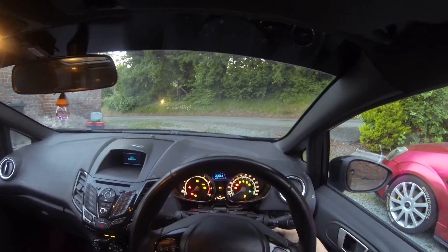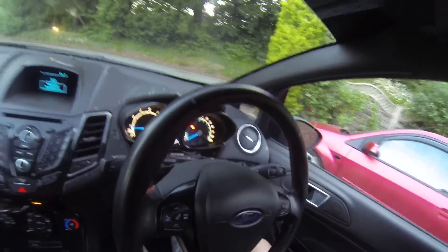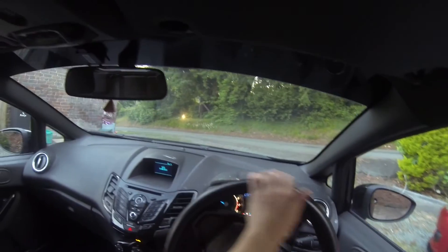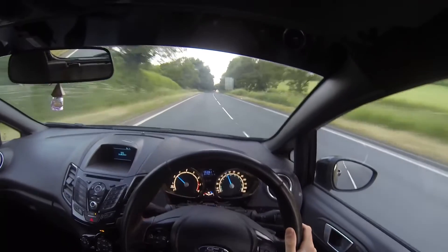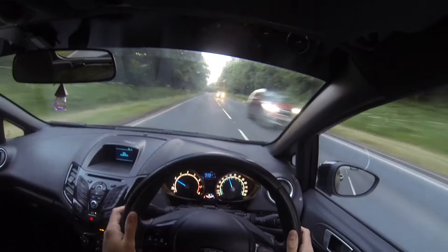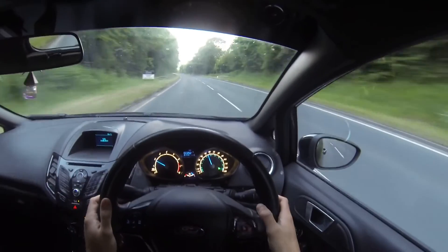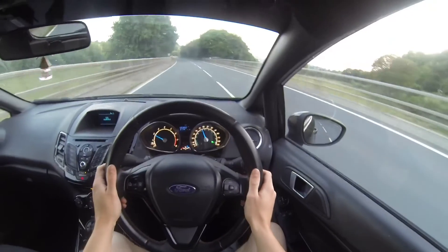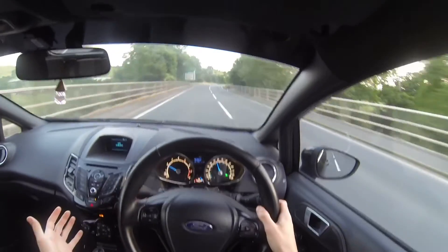Jumping in the car — there's an icon on the dash that's to do with cruise control that I don't think popped up before. You've got to be above 20 miles an hour to use cruise control, so I'm going to get up to 60 and see if it's actually going to work. There's an on button in the centre which you press first, and then I press the set button — and you can see the cruise control icon has come on. Taking my foot off the accelerator, we are held at 55 miles an hour. It's working!